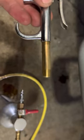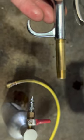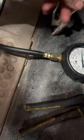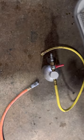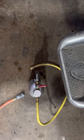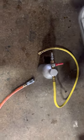I took the tip off of it, got a 1/8 MPT male to male, and on my gauge side, on this hose side, that's a 1/8 MPT as well. So basically I took the gauge off, put that in there like that, hooked that up to my pressurized can. I went to two bottles, filled that up with oil, put air to it, pressurized the system. Like I said, I did about 2 cans, and I think it's about a quart, so I'm gonna say 2 quarts.